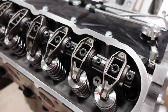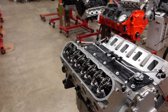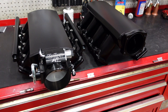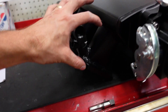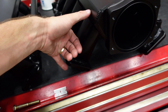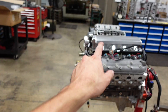Here you can really see just how many bolts there are holding down one rocker arm. This valve train is going to be so stable and perfect for those high RPM sustained moments when it's just sitting there over 7,000 RPM. So there's the long block buttoned up, ready to go. We do have two intake manifolds that we're actually going to test on this engine. We're going to start with the one that has a larger center plenum and shorter runners — generally this manifold will support a higher RPM torque curve compared to the other manifold, which has a smaller plenum and a longer runner that creates greater air velocity and will promote a broader torque curve.